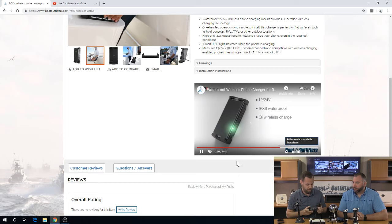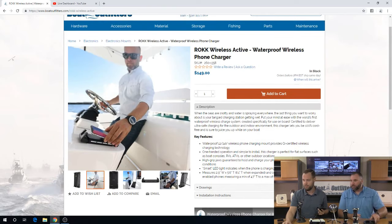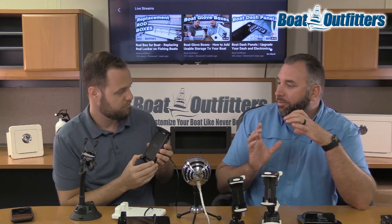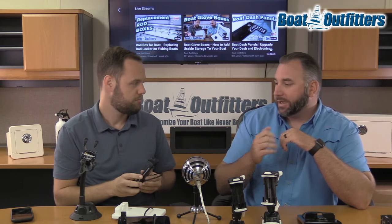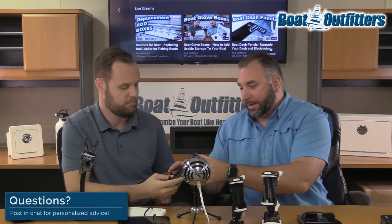We're jazzed up about this part, and it's probably the reason we elected this as the Facebook Live topic. Let's talk about pricing: right now it's $150 — quite a bit more expensive than the $45 acrylic option, but you've got the unit charging, one-hand operation, full access to your screen, and all buttons are fully accessible because it captures the phone from the top and bottom. You have access to the sides and you're unlocking phones with facial recognition or fingerprint ID — everything is wide open. The self-centering is particularly important with inductive charging because the center back of your phone really needs to line up precisely with that Qi charging puck, which is uniquely challenging when you have variable phone heights. This unit solves that by opening equally on top and bottom so the center point of your phone always hits the puck.